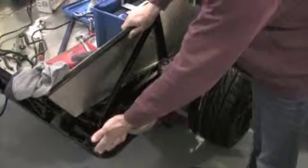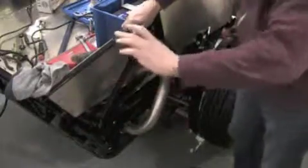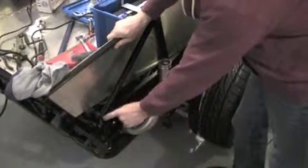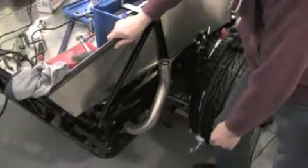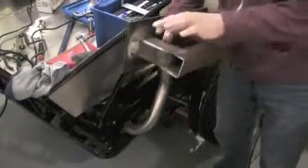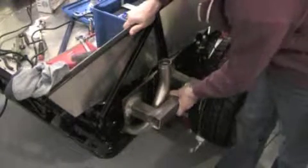I'll paint this, drill holes, and bolt it to the side as opposed to welding it — the reason being that the rear end of the car actually flares out to meet the tire, so from the side of the tire back it tapers into that rounded oval cam back. There's enough space here — by my measurement, two inches in from the end of this frame is seven inches of clearance out. I made this six inches out, so I should be just clear of the body. If it's a little tight I can grind this corner, or even cut and reweld it and move the whole thing forward, but I think I'm going to be fine.